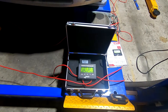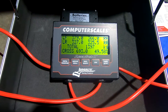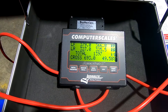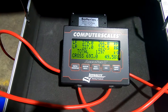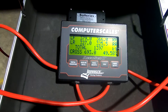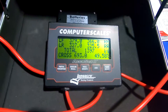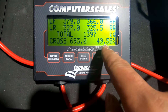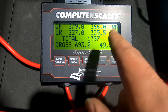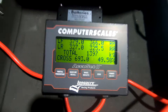Back from reading the instructions — we've got the total weight on there. Total weight with no one in it is nearly 1,400 kilos. That's with, I don't think it's got any fuel in it — maybe a quarter of a tank — full trim, full everything, but no driver. Cross weight is actually pretty good. The cross percentage — that's the difference between rear right to left front and left rear to right front — is at 49.5%, so it's almost 50/50. Not bad, but when I get in it that's definitely going to change.